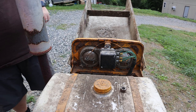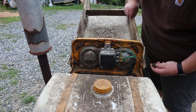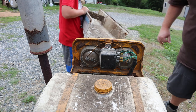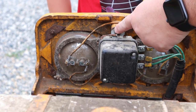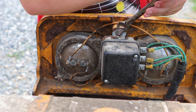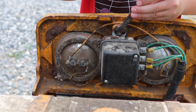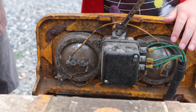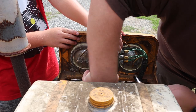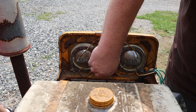We're going to use that bin to put all of our parts back into. There's one on the top and there's one on the bottom, right in the middle. What size is that wrench? 7/16ths. This is the voltage regulator - the bolts we just took off. Let's put them right back in these little holes and throw them halfway through so we remember where they go.